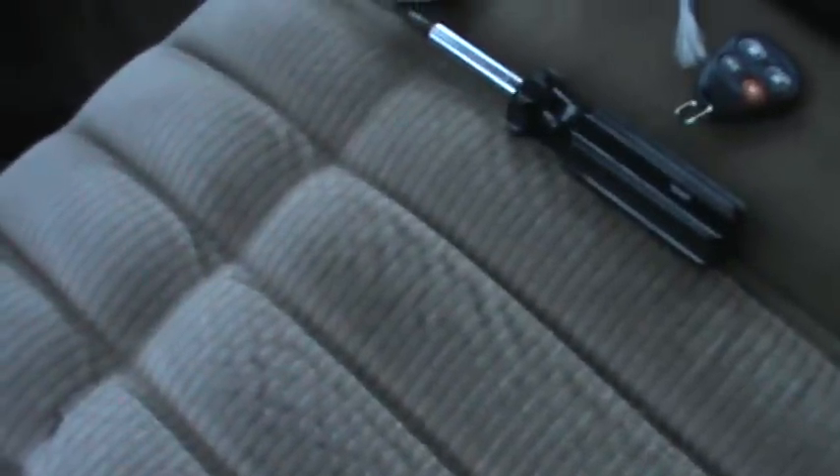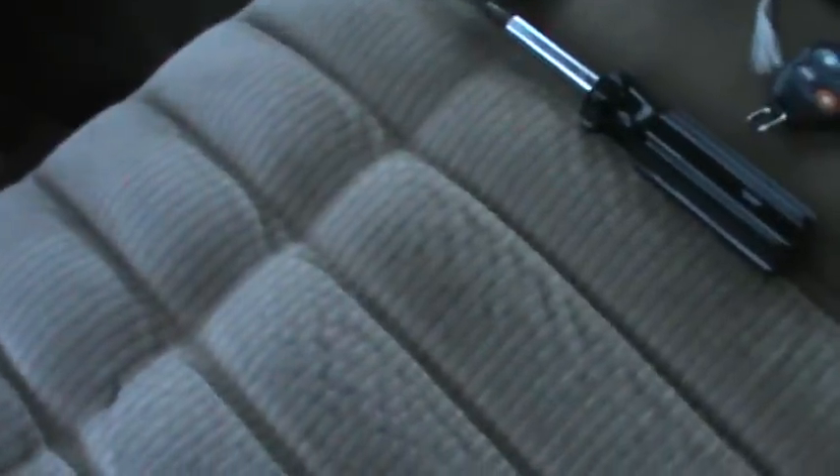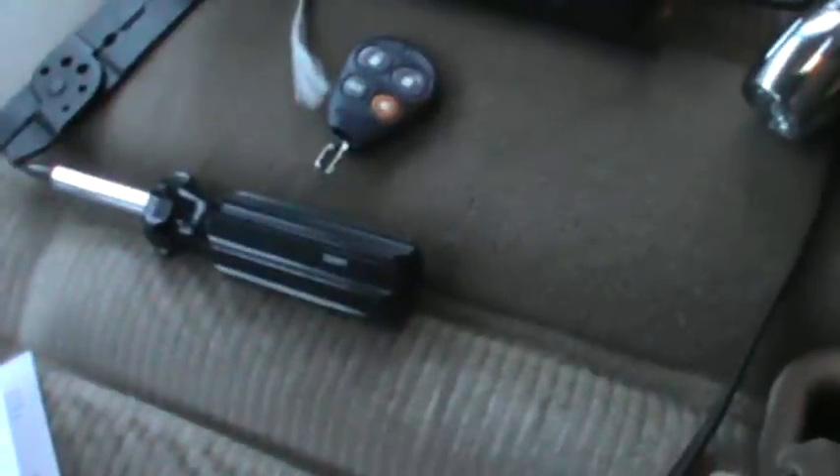First of all, for your own vehicle, if you're going to do this, you need to go online and find a wiring diagram. I've got my laptop out here. That'll tell you the different colors of wire and what they are. For this particular one, I was looking for the door lock and door unlock wires. I don't remember exactly what was hooked up where so let me pull up that information.